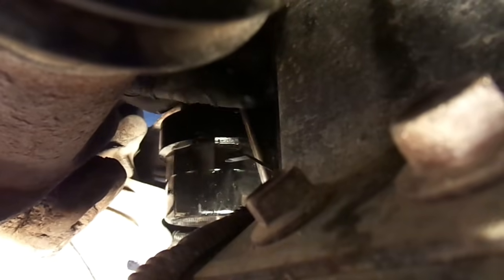You get that? And what I do is I usually take that flathead screwdriver when I start, and I just put it back there. I just put a flathead screwdriver between the hose and the clamp. Now mind you, like I said earlier, these are going to break, so just plan on getting new ones. Pull it out and don't be rough with it. Just keep working it. Usually it's full of dirt and dust and what else is up there, and eventually it just comes out. Okay? After that, your hose is pretty much just, you can slide it off.